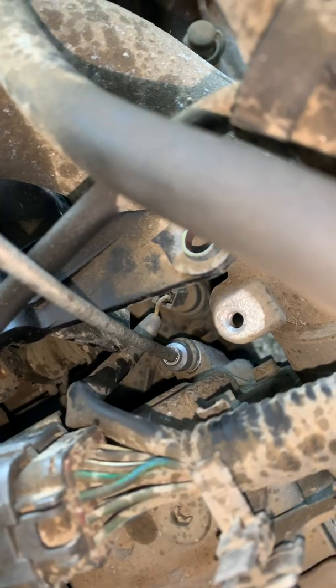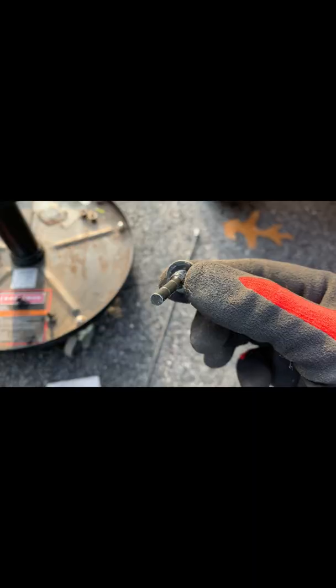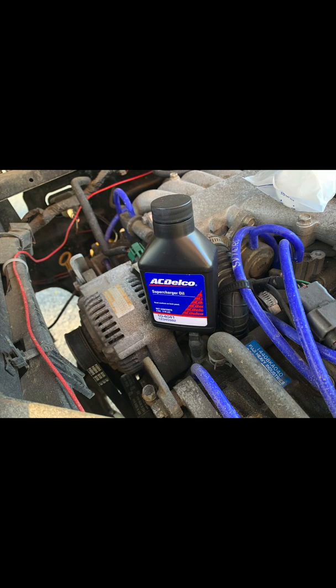The supercharger took 80 milliliters of the special sauce. So if I left 10 milliliters in there, that's a good portion. I'm happy with that. I just kept periodically checking the drain plug, making sure there was enough fluid in there. The fill capacity for the AMR300 is 90 milliliters. Keep your supercharger's bearings bathing in the nectar of the gods.